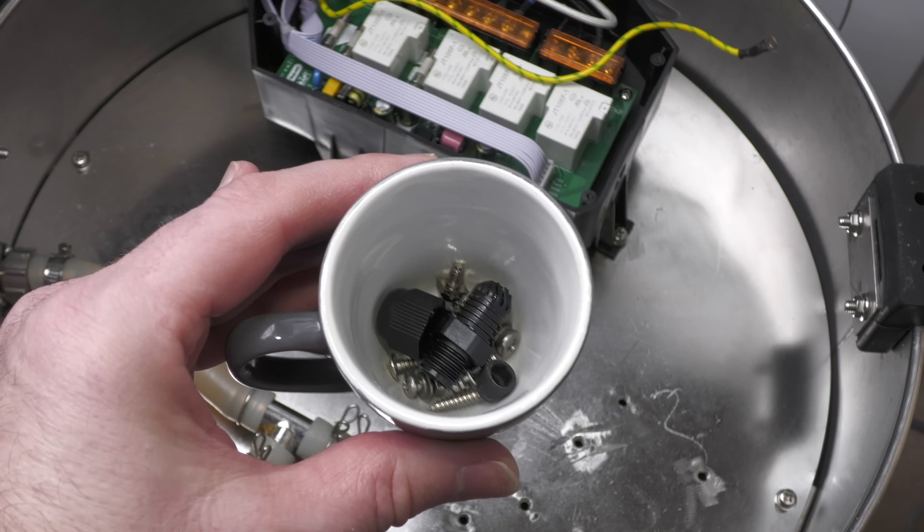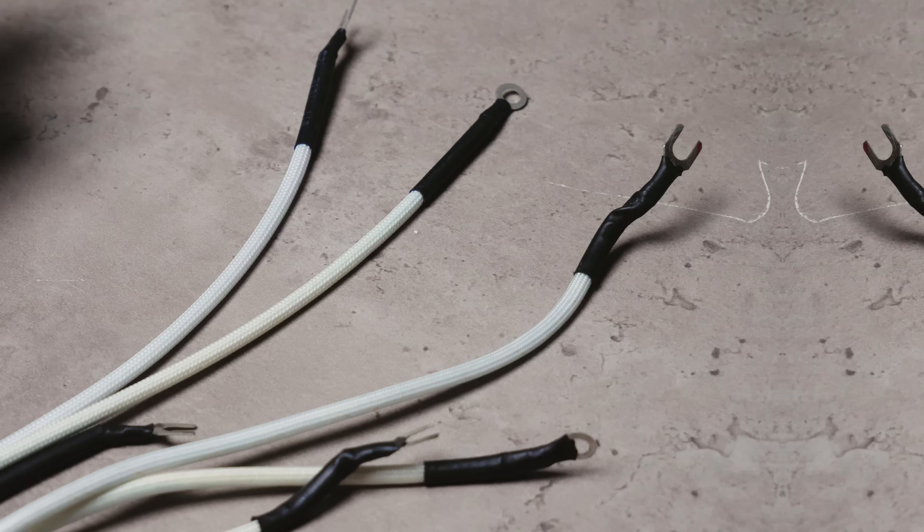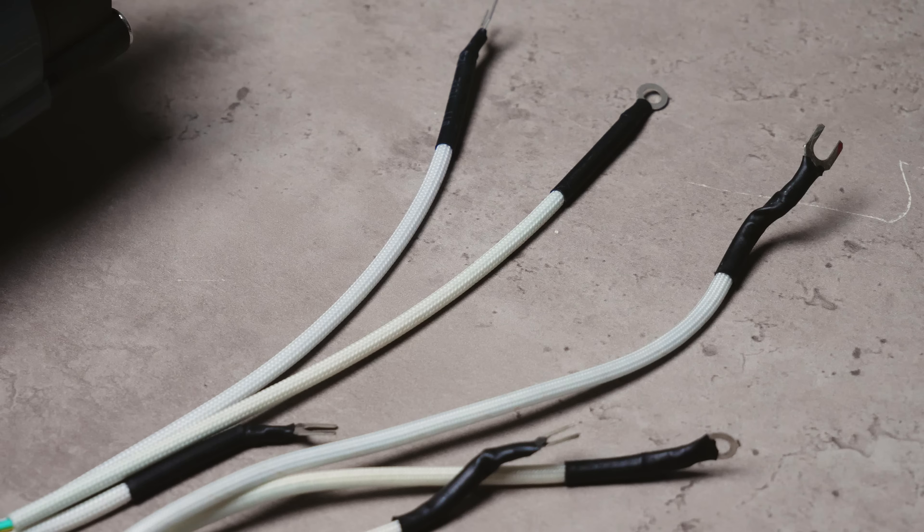As you go through this removal process, make sure that you keep all of the screws and fittings as you will need these for the replacement pump fitting later. Now we have the job of adding the upgrade pump and of course making sure that we put the right wires in the right places. However, this is generally made very easy as the wiring will generally be at the length to suit when it comes to pumps for brewing systems when obtained from the company who makes the system. This is clearly seen when you compare both pumps and their wiring, as I'm showing on screen now. In this case, both pumps have short lengths that have a spade connector that can only fit into the nearest terminal on the board, which is our neutral. Then a longer length that has a circle connector, which we know from removal is the earth connector that goes to the body. Then we have the remaining two long lengths that have a spade connector which can reach the furthest terminal, which is for active. Completing the wiring.